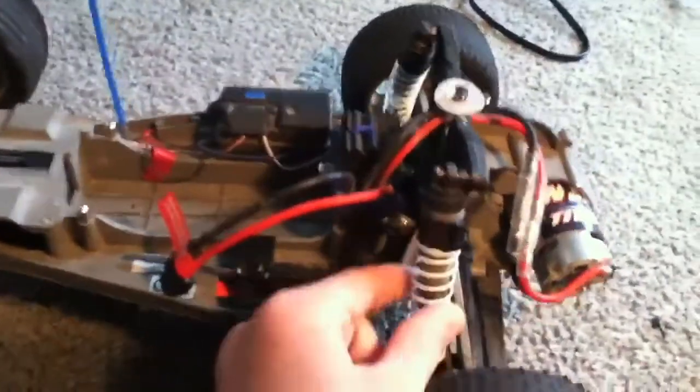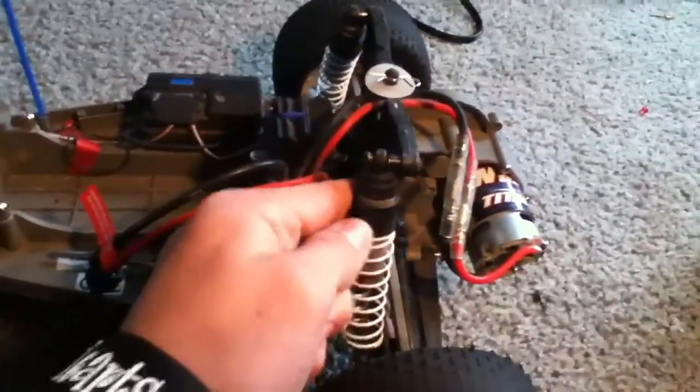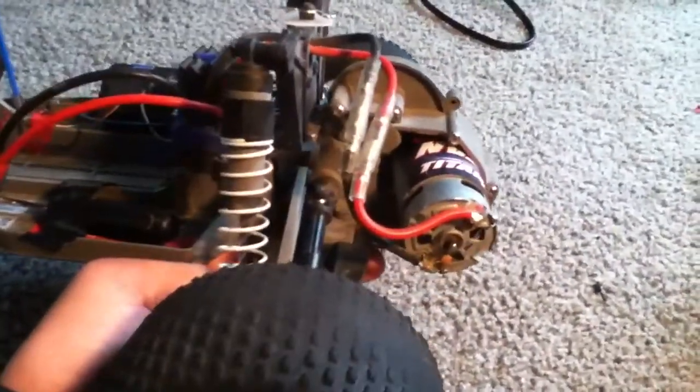It comes with plastic aluminum shaft shocks with lots of preload. I preloaded the back one time too much and it snapped my A-arm.